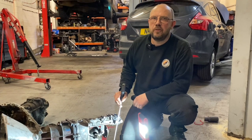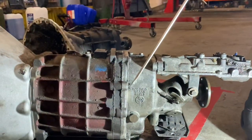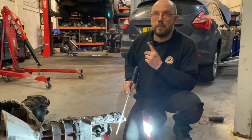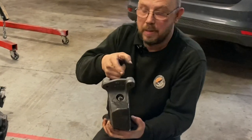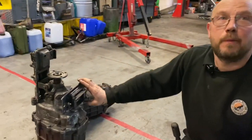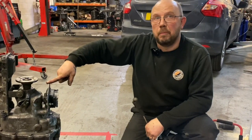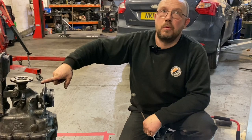Even with the tunnel mods this box is still a tight fit, but if you remove this bolt here it makes getting the box in and out a lot easier. You can put the bolt back in afterwards - once the box is up in the hole the bolt goes in. This is the original P6 gearbox mount - no use, it doesn't fit the five-speed. Instead you'll have to fabricate something. I believe this mount is fabricated from a TR7 mount but I've seen loads of different variations. Most people will make a mount up out of what they've got.